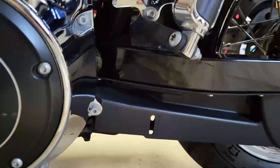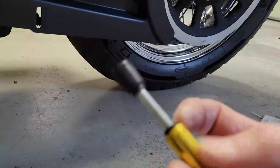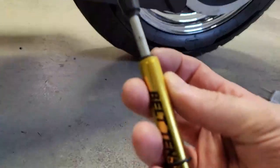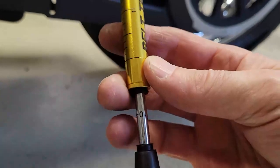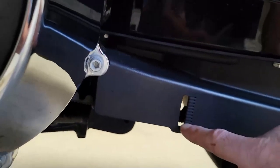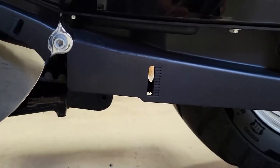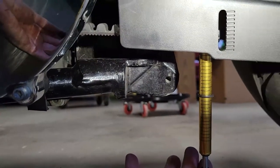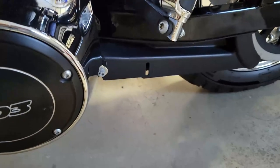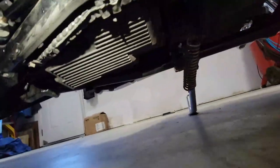One of the last things is to check the belt deflection using this tool. You put the O-ring all the way down to zero. Apply pressure — push up until the O-ring goes to the number 10. While doing that, look in the belt deflection window which has graduations — each graduation is a sixteenth of an inch, and you want deflection between a quarter inch and five-sixteenths. After lowering the bike off the lift, the last thing is to take a good look underneath for any leaks or anything out of the ordinary.